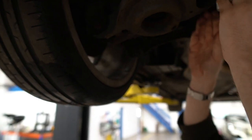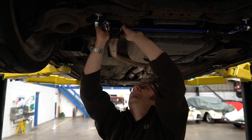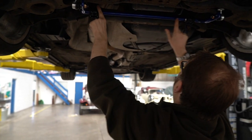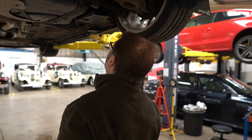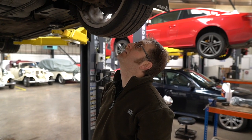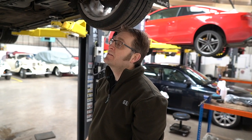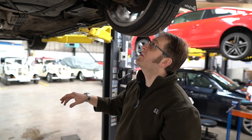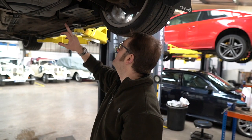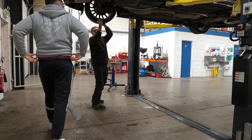Everything that was disturbed is tight — ran all the way down and in, flush. Those little bits — I just think it's because the rear end is now so much stiffer, it's bringing out any other issues that could potentially be there. That's exactly it. We're definitely going to need to do a video on the channel where we do all the bushes on the rear end. It's going to be a lengthy process, but the stiffer you make it, the next weakness will show. The bushes in the lower arms, the trailing arms, and the forward links are probably getting torn up a little.